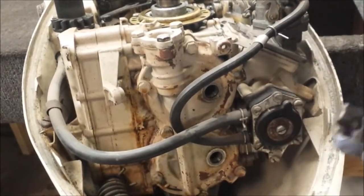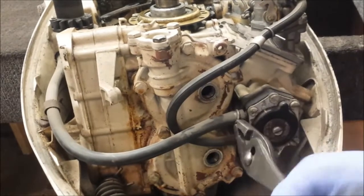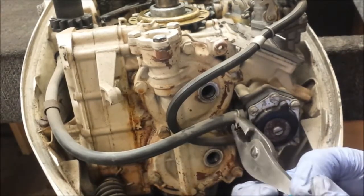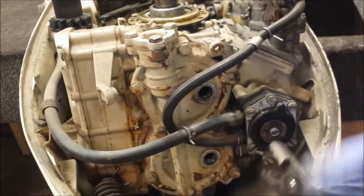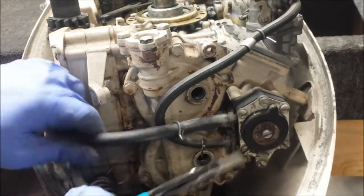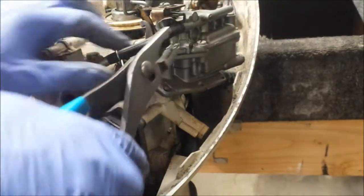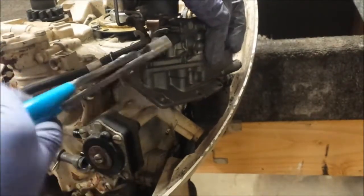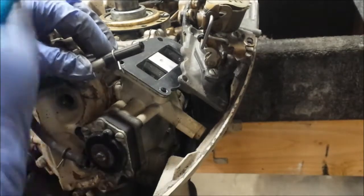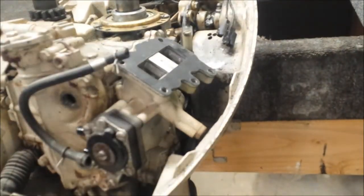They even have an inner slot to fit those weird-shaped ones. So what I'll do is pull all the hoses off. As you can see, there's a good reason to replace these old fuel lines — that one broke rather than just coming off. They're pretty old, pretty brittle. That's our carburetor part off.